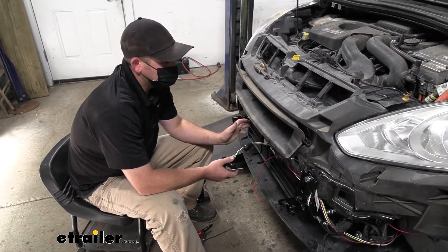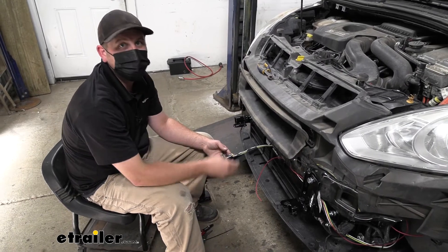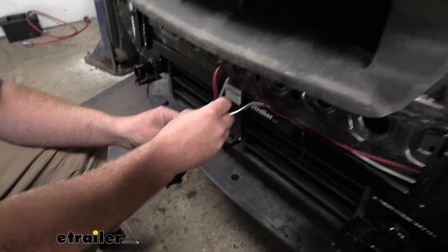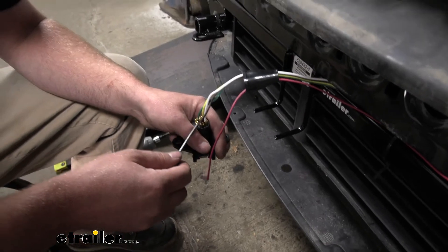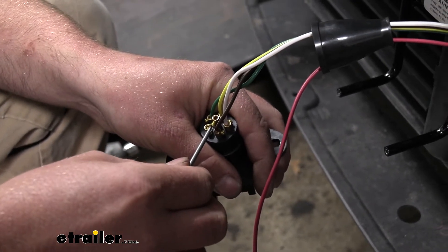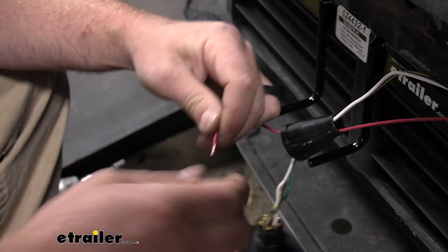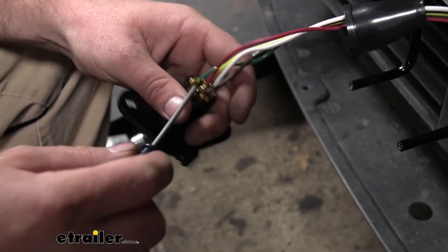To begin our installation, we're going to be here at the front of our C-Max. We have the front fascia removed — I'm doing this at the same time that we did our base plate, which makes it a lot easier with all this extra room. But you don't have to have all this stuff off to get this job done. The first thing we're going to do is grab one end of our wiring and put it through the dust cover on our connector plug. Then at the center post, we're going to back that screw out — don't take it out completely, it's hard to get back in, just take it out a little ways. Strip back the insulation on the end of our charge line, give it a good twist, put it into that center post, and tighten down that set screw.